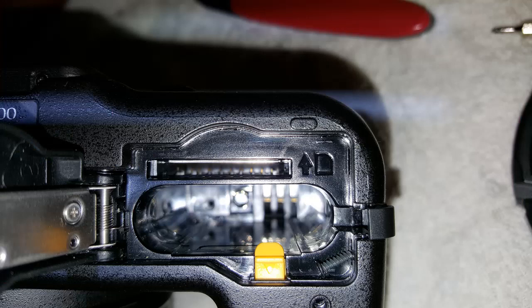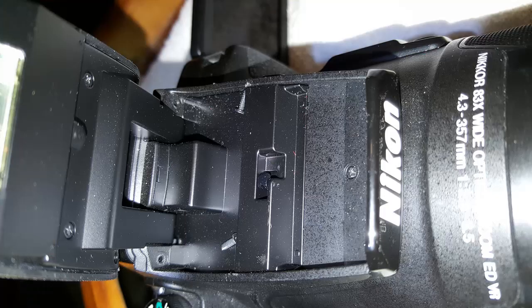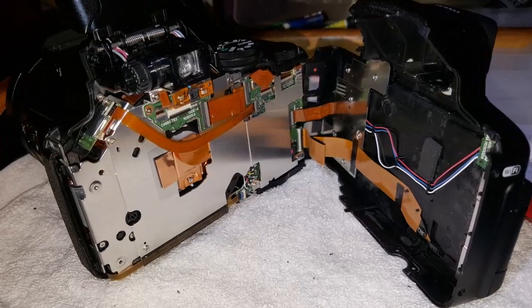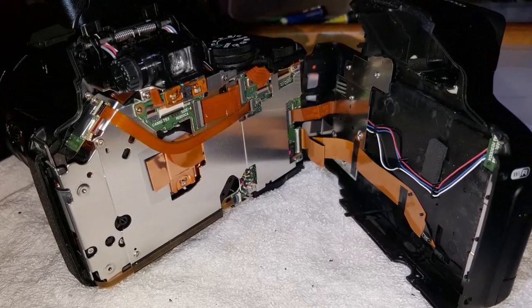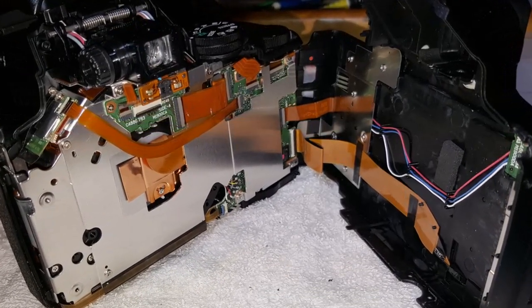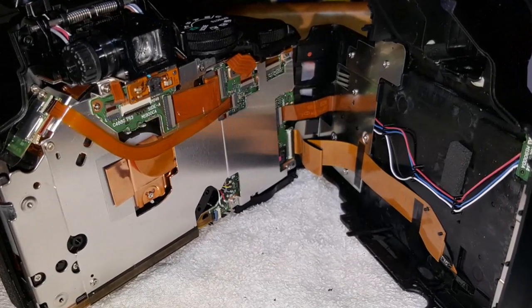First up remove the battery, then remove the case screws holding the back. There's two screws on the back side of the camera near the mount hole. You don't need to remove all four, just the two at the back. Then you take one from near the battery flap but don't pull the one out from inside the battery flap. There's two screws on the left side, two screws on the right side, and that one under the USB flap. Then there's two screws in under the LCD. Once you've got all those, there's a little slot between those two screws and you can pop a little screwdriver or spudger in there and pop the back off.